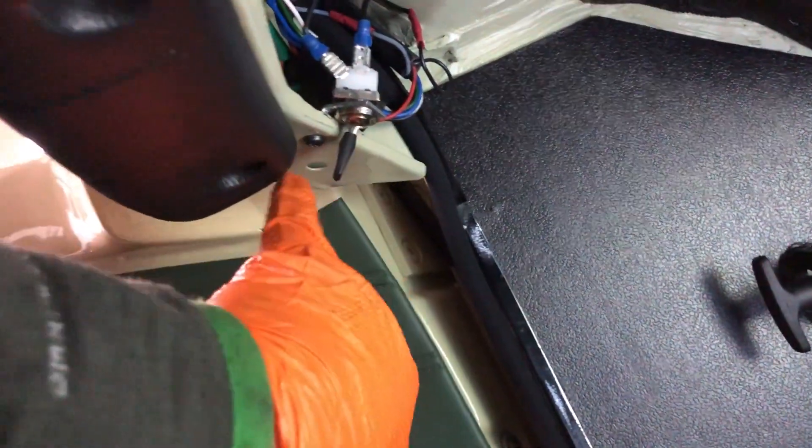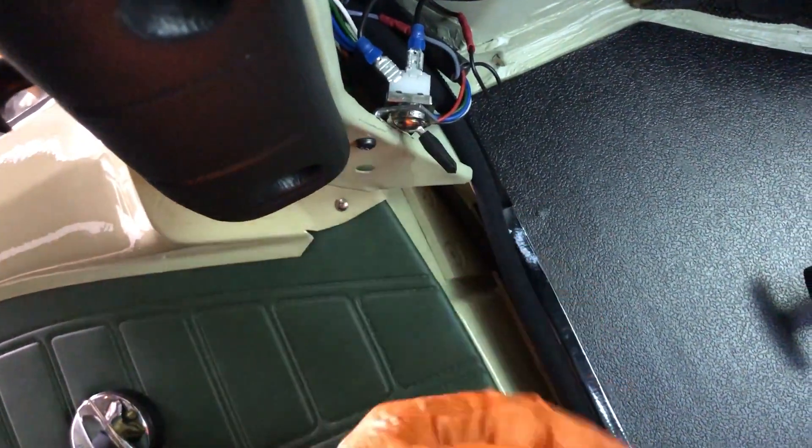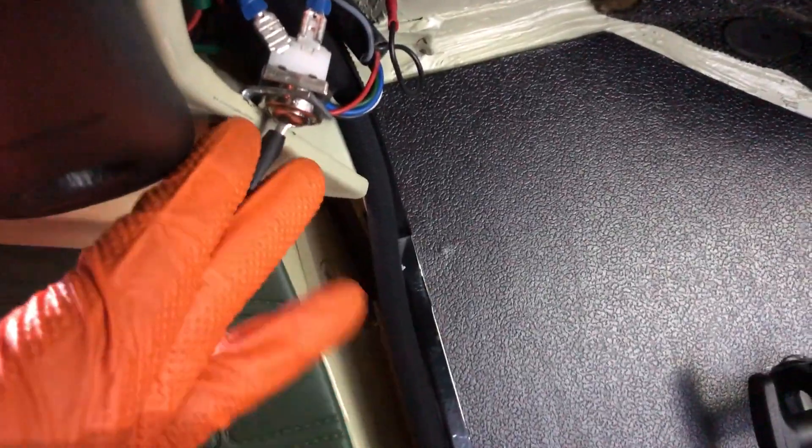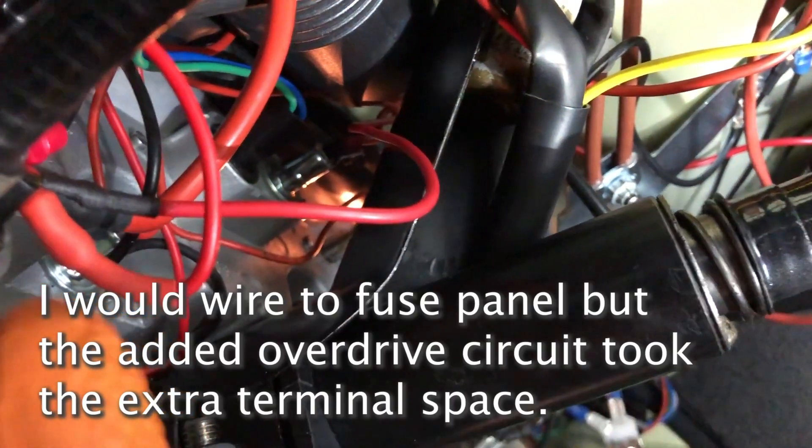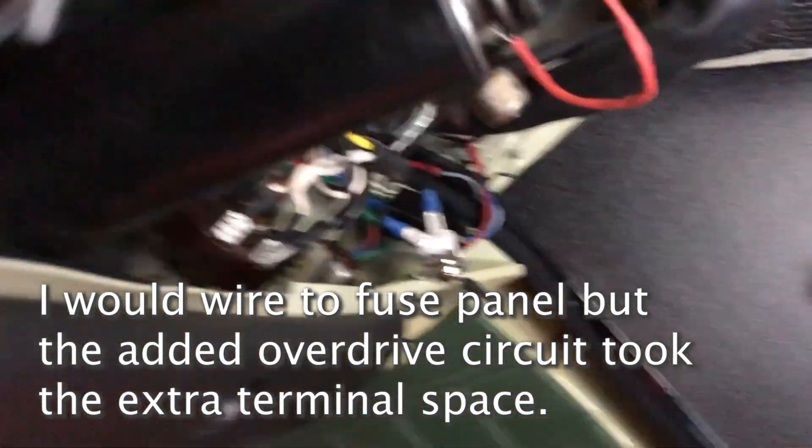Here's a better view of the relay. I've decided on pulling it toward you to activate it, the same way that you'd pull the light switch toward you, pull the choke, or the wiper motor switch. Switch is available through VP Auto Parts and has a really nice detent to it. The power to the relay goes under the firewall blanket right up here, then I routed it around the steering column. It's the fourth wire going to the ignition — we've got the radio, the big fat one going to the fuse panel, and the cigarette lighter, so that's all four.